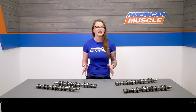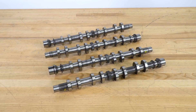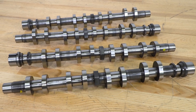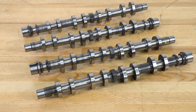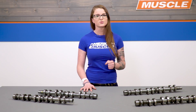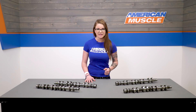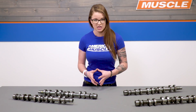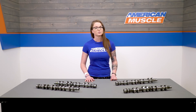It's a pretty functional all-around cam for those blower and nitrous cars for the street or track. So how are cams beneficial? It can get pretty technical, but in the most basic sense, the cam lobes on a performance cam are shaped differently, and that actually helps the engine to be more powerful. What it does is change the valve lift or the valve timing. Changing lift lets more air into the valve, and changing timing changes when the valves open and close, which has an impact on the effective compression ratio and the power output. What all of this means is that you're optimizing airflow with the camshafts, and it's very important to get the right camshaft for your build — if you don't, you can actually hurt performance instead of help it. You want to consider specs like lift and duration, since that's what tells you how your valves will be opening and closing.